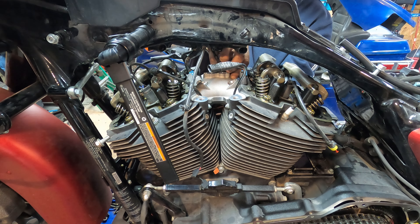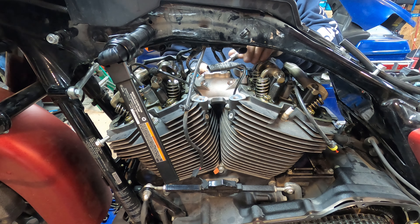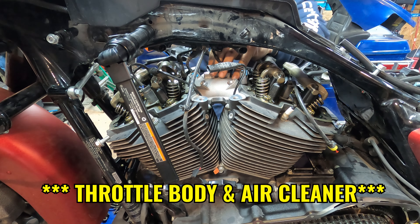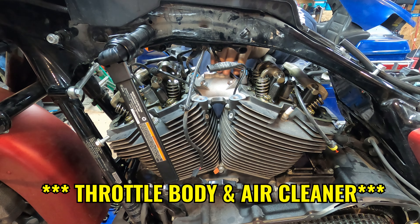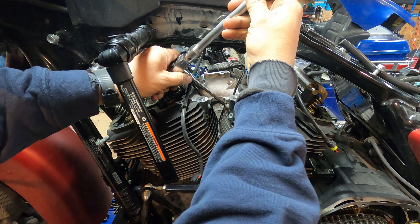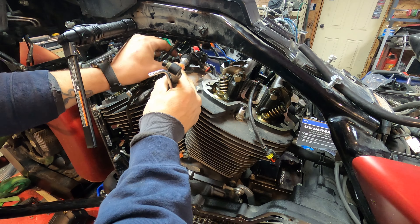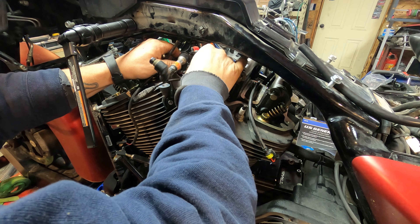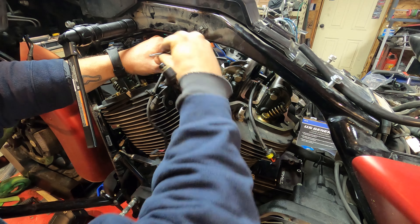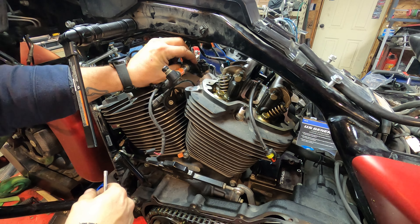We're going to make sure these go on the bolts. Now that it's in there, we can get the other bolt started — just run it in a little ways, same thing over here. Remember, they say to only get these hand tight; don't tighten them down until you get the throttle body installed so everything is lined up. Get the front ones just snug, then do the same with the rear ones — snug but still able to move. Then get the fuel rail and injectors installed nice and tight.